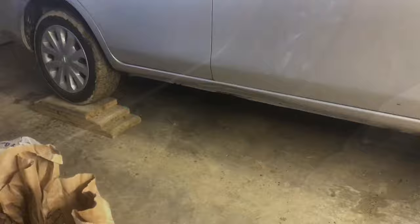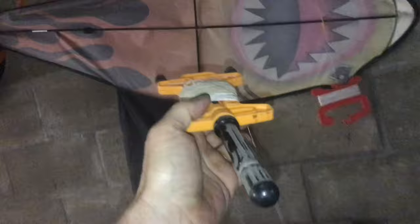Lifting the car up like this allows us to get underneath the car so we can reach the steering connection arms. You can add some oil to these stop nuts to loosen them up. Now we can line up our strings — I have found kite string works really nice.